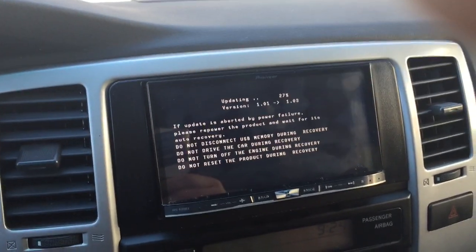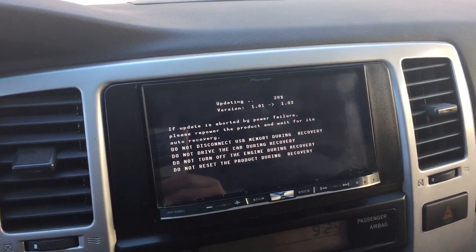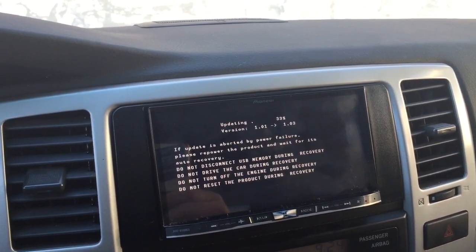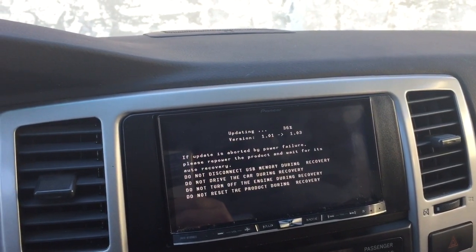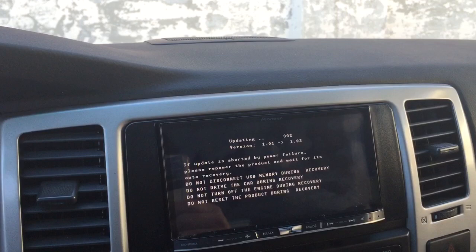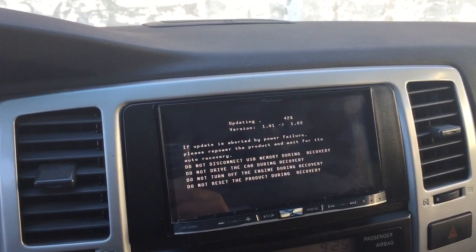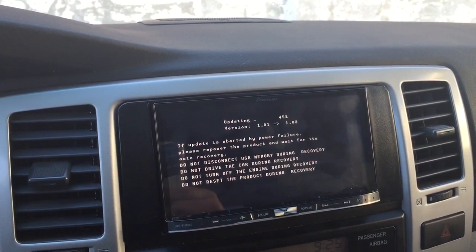The USB directions say it needs to be FAT32. If you buy a USB drive in the United States, it's going to be FAT32. But you can always right-click on that device — plug the USB stick into a port, find it in My Computer where you would see your C drive and any other drives. If you right-click on it, one of the options is to format. When the format dialog box comes up, you have the ability to select FAT32.